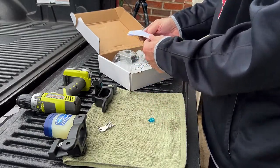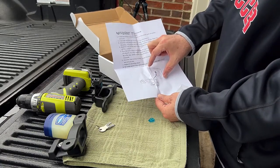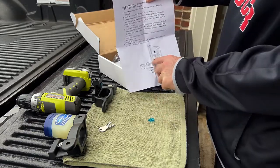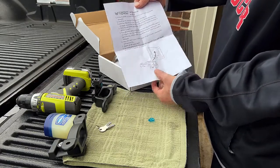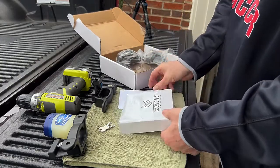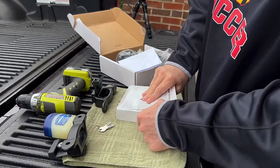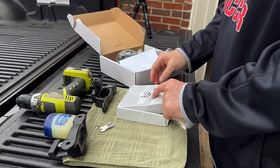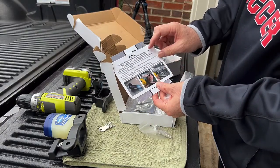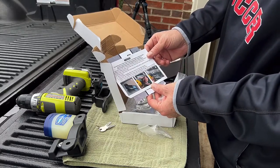There's also a set of instructions on how to install these cleats. This powder-coated bracket that you're going to screw onto the truck — it kind of looks like a little space invader or a rocket ship taking off. Make sure that you put it in the right orientation with the rocket ship sort of facing up. Then you just slide the cleat in there and it's literally going to be that easy. I'm going to leave these instructions in here for you as well. The last thing we need to do is drop out the screws. The bolt holes of the truck bed are unthreaded, so follow these steps: add some lubricant — it's asking for candle wax — and then kind of screw in each bolt a little bit before you do the final placement.